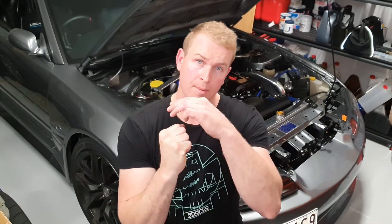A couple of notes on doing an engine compression test. You need to remove all spark plugs and when you go to test you need good battery voltage — a good recharged battery. It's always a good idea to stick a jump pack on it or a battery charger. Make sure the motor is at normal operating temperature and when you go to test, make sure the accelerator pedal is all the way flat so you're getting a maximum amount of air coming through. Another important thing is to remove the fuel pump fuse — you don't want the injectors spraying fuel while you're doing the compression test, as fuel in the bore can actually score your bores.